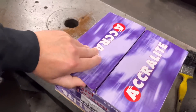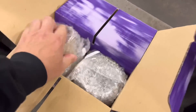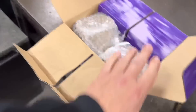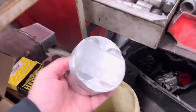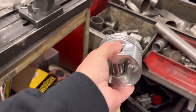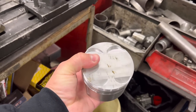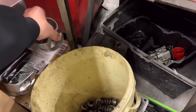So if I just open these, you can see they've got the nice bowl on the top - very, very nice item. These are going to end up with that cylinder head at about 12 to 1 compression, but these flat top ones are just going to be too low. I'll make use of them even if I have to use them for a turbo in the future - there's about 10 to 12 mil of crown thickness, so I can put a bowl in there and use them for turbo applications.